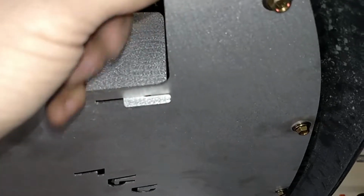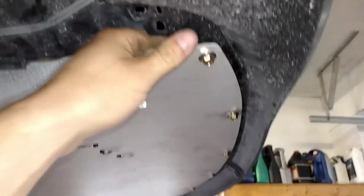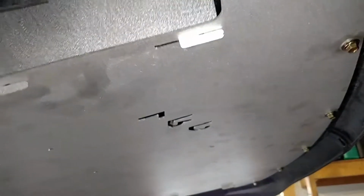Right here on the side piece on the front, I do have 5 washers underneath the front bolt, just to tip the front end down a little bit to give it clearance to the bottom of the Samberg radiator. And then these 2 front bolts right here, those are the short ones that come with the LRB kit. These are the long ones that come with the LRB kit. And then the very far outside ones are the long ones, but I think because I dipped this front down, it wants to hang a little bit lower, so I have a spacer up there. I bet you could grab this arm and tweak it up a little bit and you wouldn't need to use that spacer.